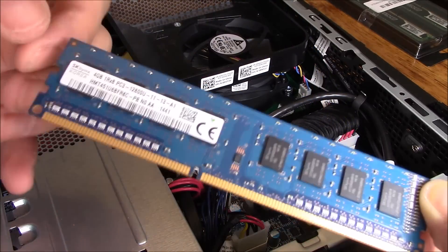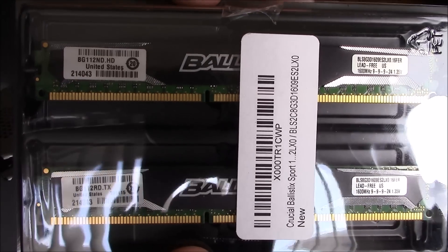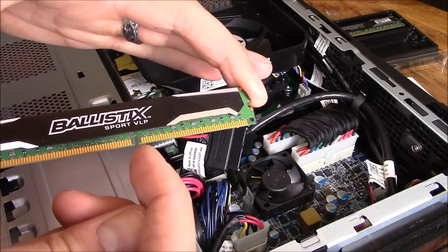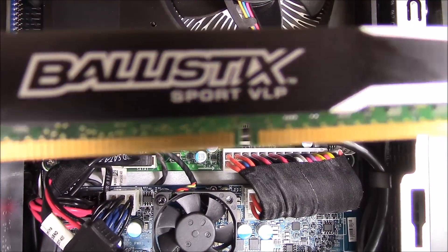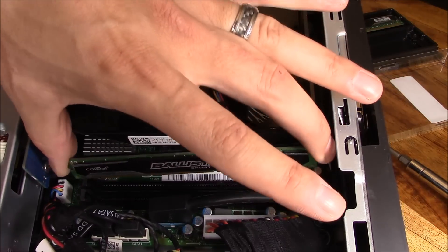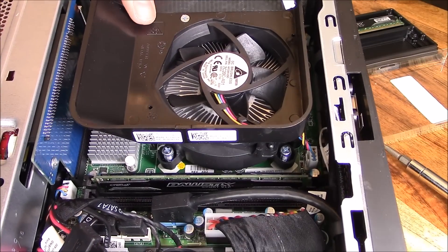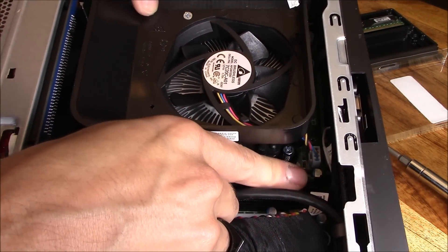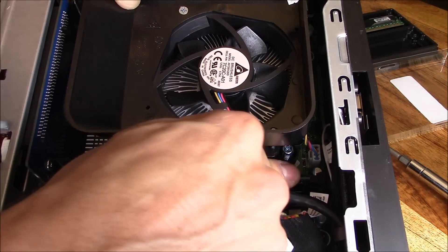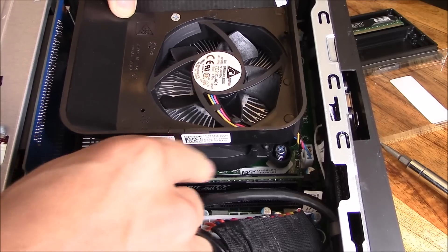So this is the original RAM that was installed if you guys are interested, and this is the new RAM that we're installing right now. This RAM has a heat sink on it. Now you see that little etched out slot right there — make sure you put it in the right way. Let's go ahead and put it in, and when you push down it'll clamp on by itself. Just like that. Make sure it's in even and flush. If it's not, your Alienware won't boot up if the RAM is not in flush.